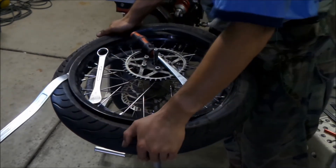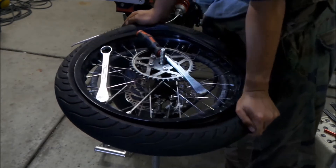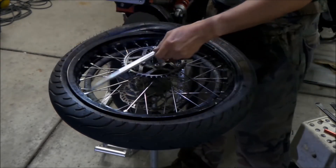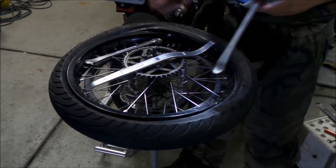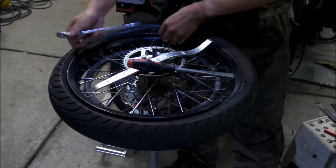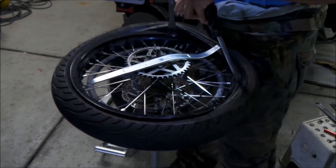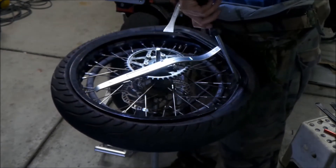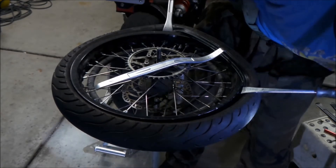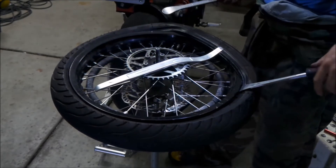Okay, that's about as far as it'll let us do by hand. From what I remember with the other one, it's good to use two tire irons — use two tire irons to spoon it on. Let's get two of them ready and make sure it's the right direction. When one goes in the other one should get easier. Make sure you're not pinching the tube and make sure you don't see any tube creeping out.